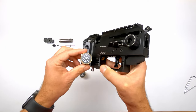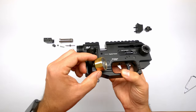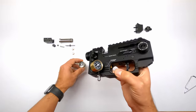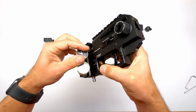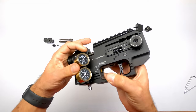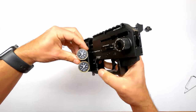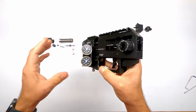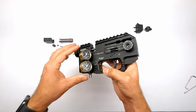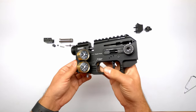These gauges normally come with a black cover on them. I painted mine to match my color scheme, but I'll have to see if they fit over the segment gauges, which are a benefit over some analog gauges — especially when you're into tuning. With the gauges installed, we go to another very important thing: the valve. That is the parts you see right here, housed right underneath where your plenum screws on. Looking deep inside the hole, there is part number one which I left installed in this one, as it seals with some very tiny O-rings very deep into the block — it can be cumbersome and a nightmare if they leak and you need to get them out. I have another valve to show you how I take those out, service them, and put them back in.